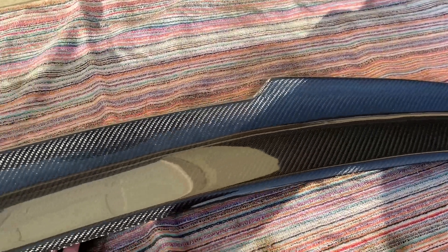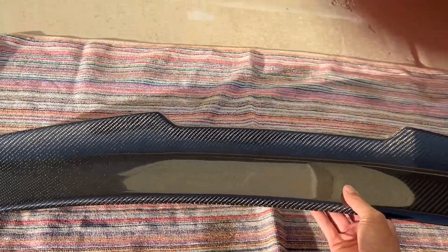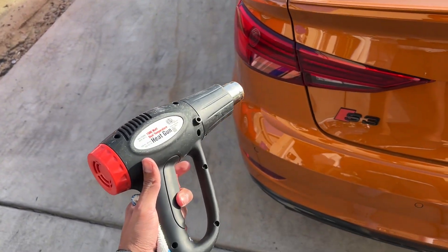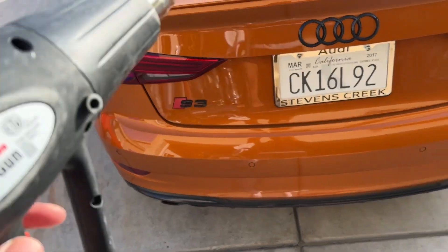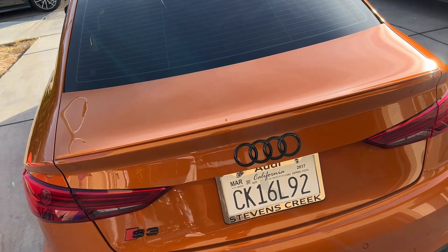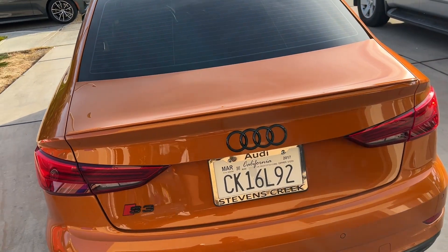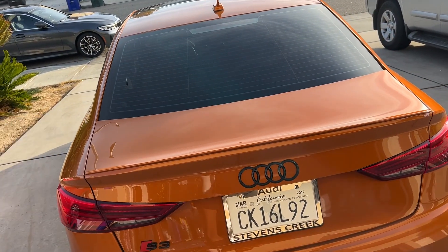Spoilers are super cheap and I don't see any reason to spend 300 dollars when you get the same quality from eBay. The last one I got for my BMW was from eBay and it lasted perfect through the weather — it gets really hot here in the desert in California, so I couldn't complain. We're gonna throw this on, it's gonna look fire. First step is taking off the original spoiler with a heat gun to warm up the adhesive. I'm gonna peel it up with a cloth — a lot of people say to use fishing line, but I really don't want to scratch the original part just in case I ever want to go back or sell the car.